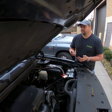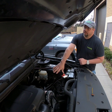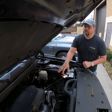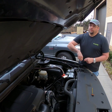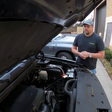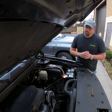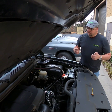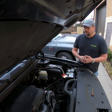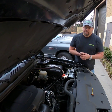Now technically you can buy this and plug it in, but when you unplug your factory 2-pin alternators — not the external regulated, the 2-pin GM style for RVC — if you unplug those it will default to around 13.6, 13.7, 13.8 volts somewhere in there. So it'll still work, but as many emails and calls as I get about needing 15 volts, I'm pretty sure you're not going to be happy with 13 and a half or so.